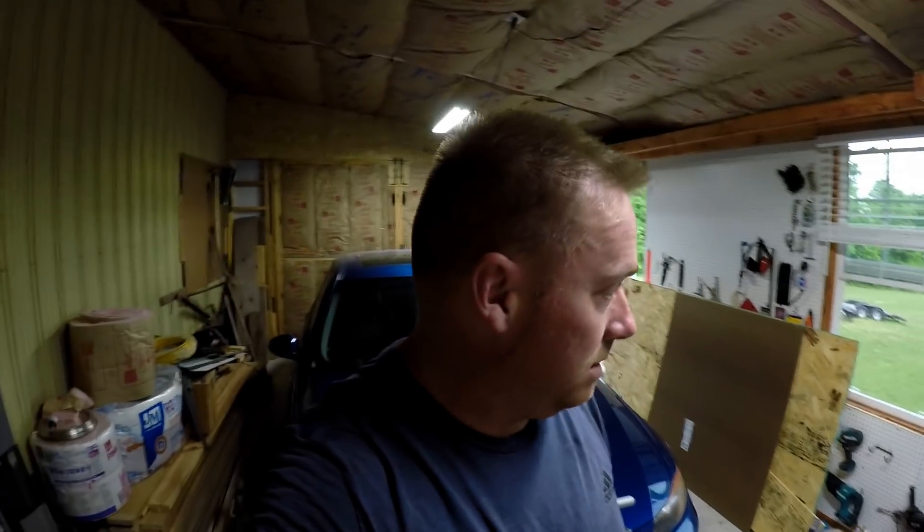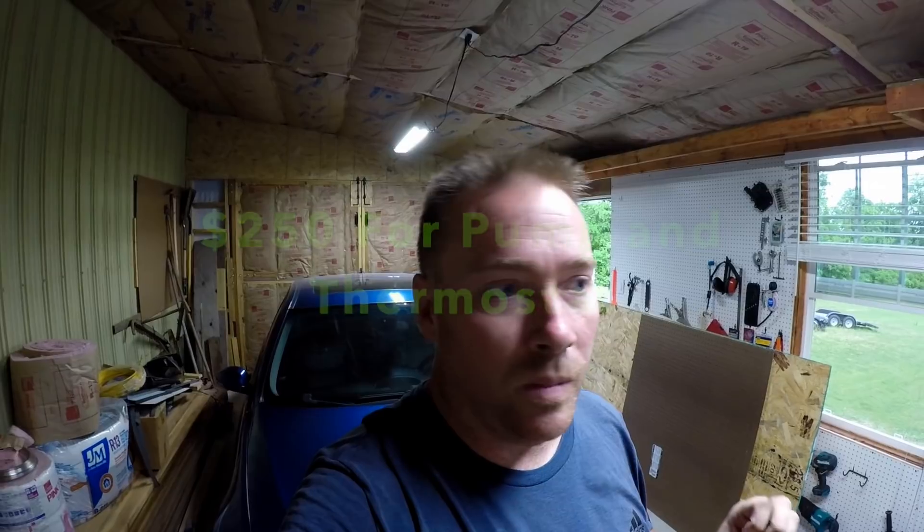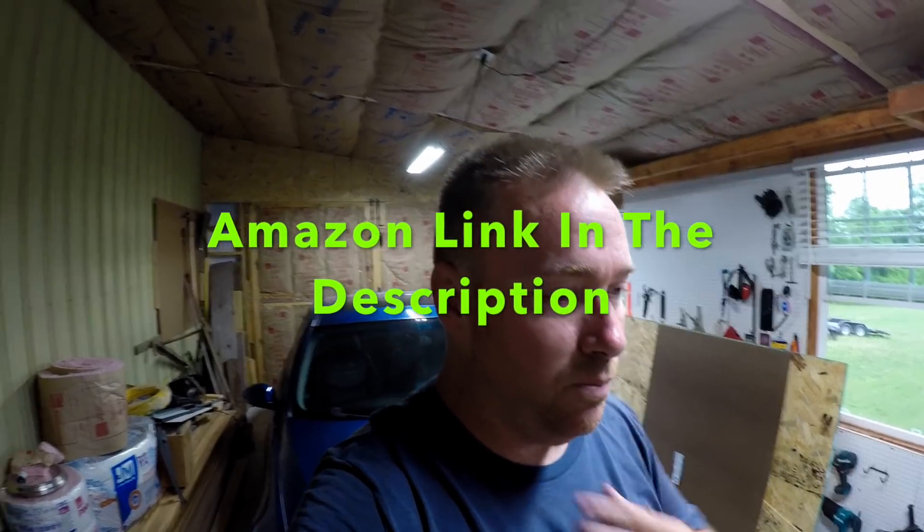Usually it lasts 80 to 100,000 miles. The N54 ones with the plastic front last a lot less. Usually the N52 are pretty good about holding up to around 100. With 148,000 though, a pump's about $200 — they vary all the time. It's about $200 bucks for a thermostat and a pump. And probably already do a few hoses, but ours look like they've been replaced. So do you waste $200, let's say $250 bucks on it, or do you not?